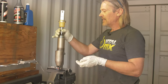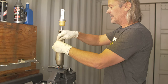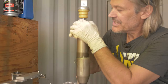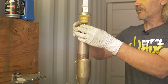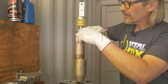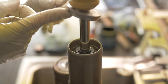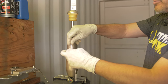Once the shock is bled and I have no bubbles, I'm going to move the seal head down to the oil — I've filled it pretty much to the top of the shock body. Don't worry about having a little oil spill out. I'll put the seal driver on and compress it as far as I can, then let the air out of the bladder, which allows me to press the seal head in. Now everything's seated; I'm going to put the clip back in this side. Make sure the clip is perfectly seated in its groove, otherwise you're going to have a mess or a nasty accident.